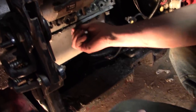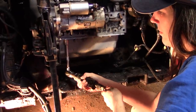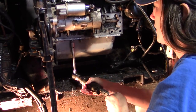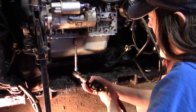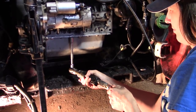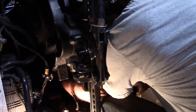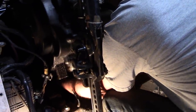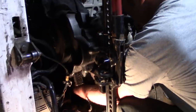You notice I'm doing the easy ones first. We've lost a bolt — we're missing one. So right now he is torquing all the bolts to 49 to 55 foot-pounds. He's just kind of checking each one — he's already done all of them, just making sure he didn't miss any. The back ones we've got to do by feel. Back ones are a little harder. Back to the motor mount.